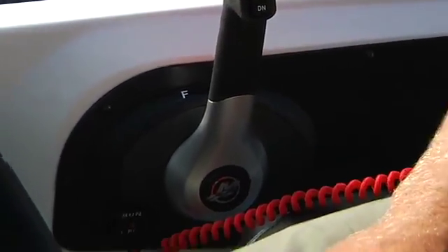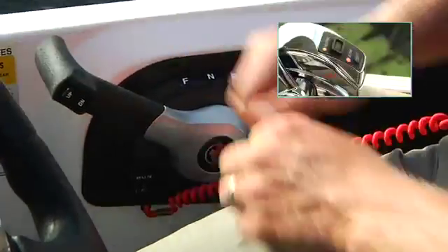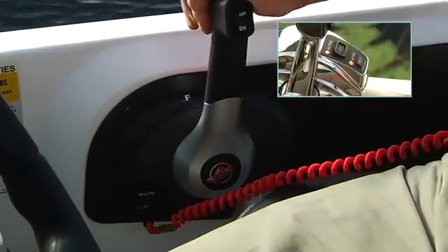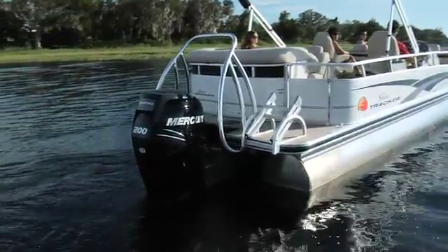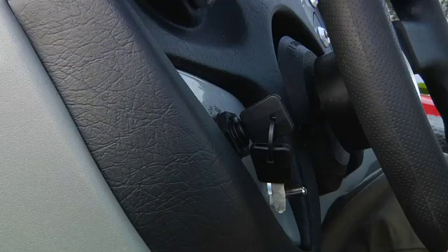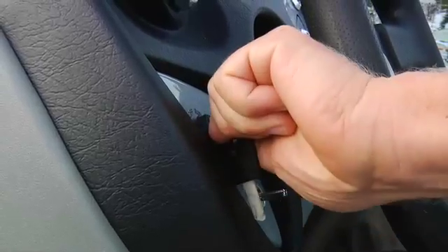When you come back to neutral, the lockout releases and you can shift normally. This procedure may be slightly different if your boat is equipped with a SmartCraft Digital Throttle and Shift System, or DTS. DTS is standard equipment on Mercury Verados and optional on some Mercury OptiMax engines. If it's cold, or this is the first start of the day, additional choking may be necessary. To add choke, push the key in as you turn it.